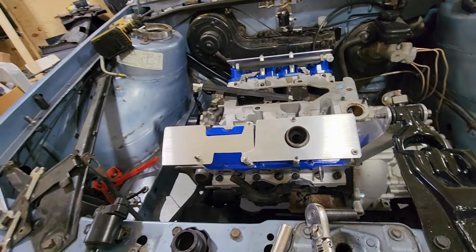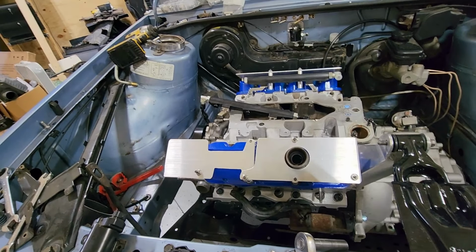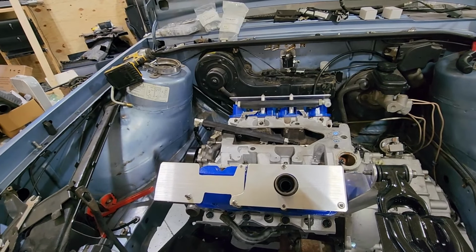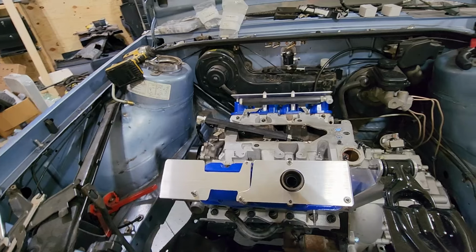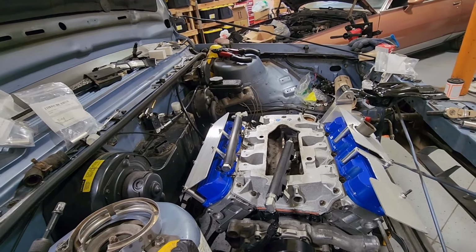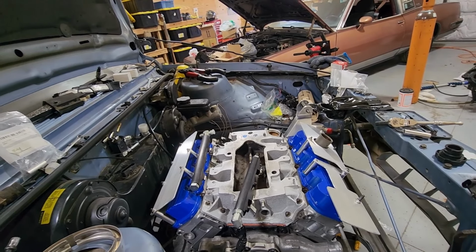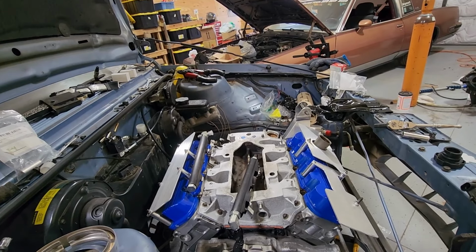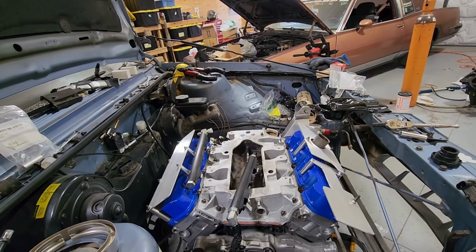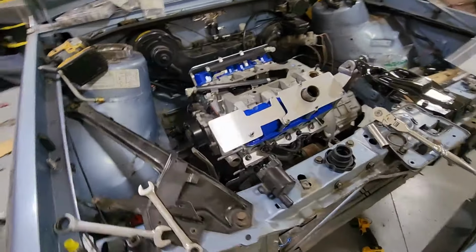The brushed aluminum looks amazing, by the way, so that's really cool, but it's a lot of it. I'll keep a little bit of it, but this is too much, if you ask me. So what I'll do then is I'm gonna figure out where these things are gonna sit, mark the holes, start drilling holes, tap the holes for the threads, and start bolting them in. Figure out what size space I need. Also need to check the clearance on the motor mount too, if I'm running this distance.